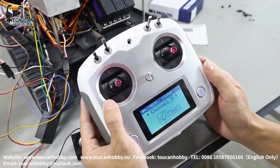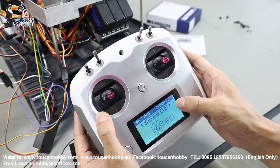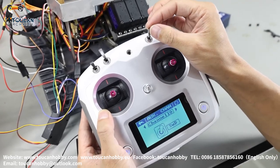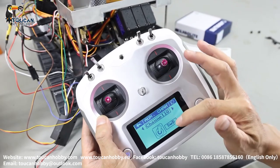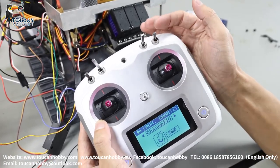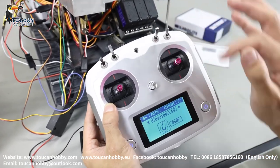Channel nine is SWC — that's the sound system start and horn. SWC is channel nine. Channel ten is SWD — that's the volume. I set up channel ten with SWD for two-level volume: low and high. By only changing the endpoints you have volume control. Channel ten is volume control.